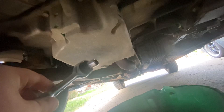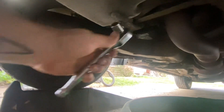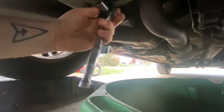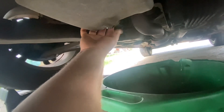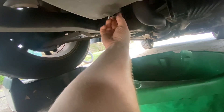This is your oil pan. You're going to go further back — it's here. This is the bolt we need to get loose, 13 millimeter. I don't know if I'll be able to do it in the first take on camera, but yeah, took a few hits — but it is off. I'll get this draining; see how much oil we get on us.